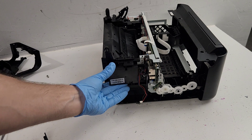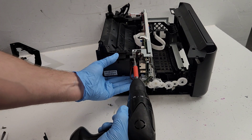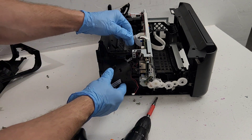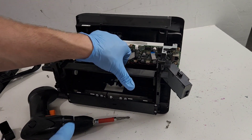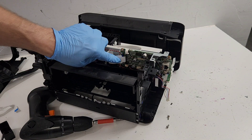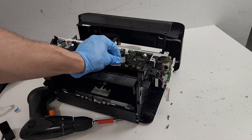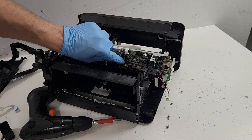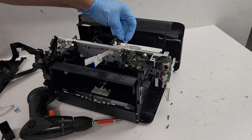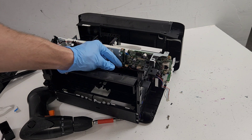The fax card - you can just remove this screw right here, that releases it, and it is also connected to the main board over here. Just go ahead and disconnect it. Some more things - this is the printhead connection over here. If you ever need that checked, the printhead just also slides in there; there's no clamp on any of these. This is for the motor, and possibly some more connections right there.